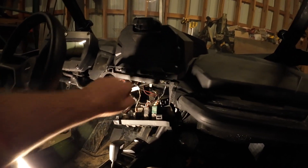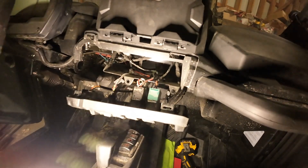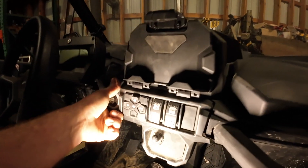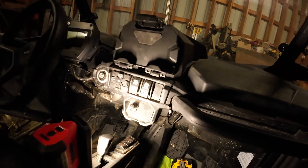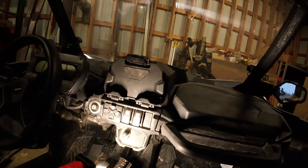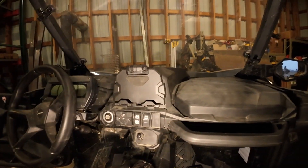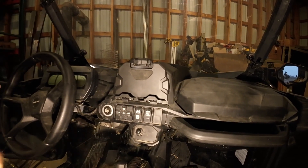So I'm going to pull that bracket off real quick, snap it back in, and then just bolt it back on. There are two 8mm bolts — one in there and one in there — and you can get to them from underneath. Hopefully you watch this video all the way through and pull those two bolts off first instead of pulling the bracket out with the face. After you do that, just snap your plastic back in and then you've got two small 8mm bolts to put back in. Anyways, there's your new electronic holder sitting in your Can-Am Commander — same as the Maverick Sport and Maverick Trail. Thanks for watching.